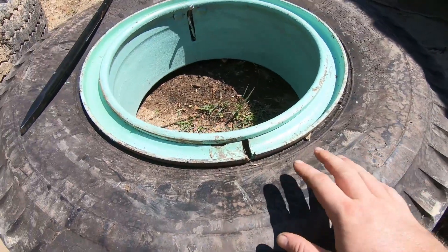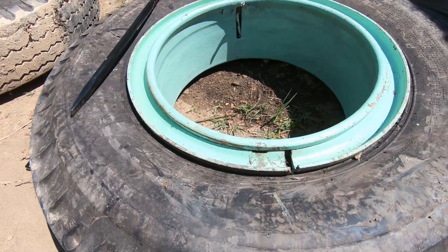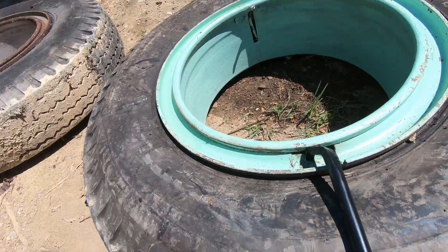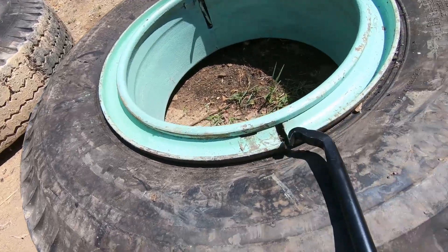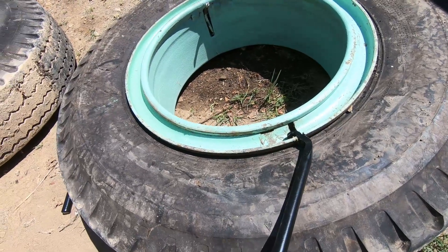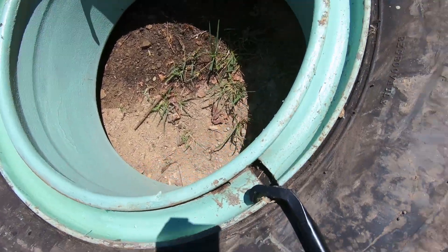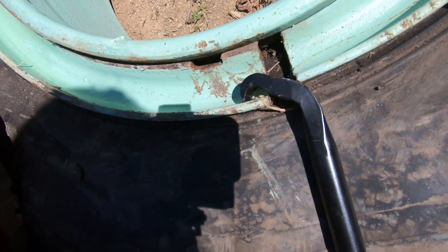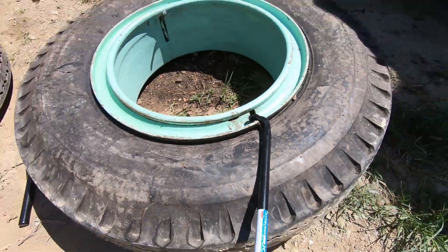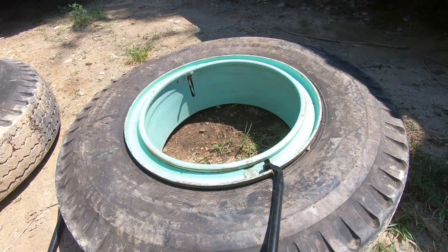There's a little notch here to help pry the ring out. The cam tool actually goes between the split in the rim — not in the notch. I'm going to try to do this with one hand. Basically you get the cam in there and when you pull on it, it'll actually separate that ring out enough to where you can get the other tool under and pry up on it. It's got to come out from under that lip. Let me put the camera up here and I'll pull this apart real quick.